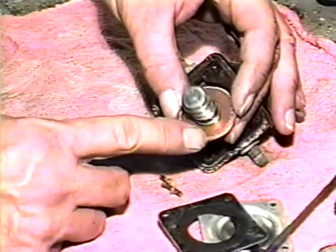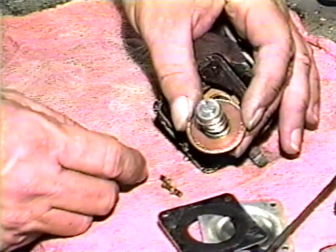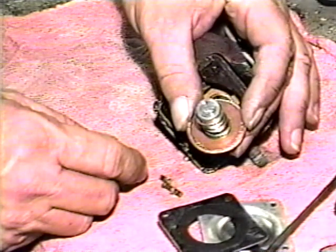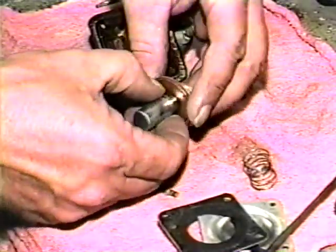Inspect the contact washer. Pitting around the contact surface is caused by arcing between the washer and the contact posts. This is normal if it is all the way around. Each time the relay operates, the washer should rotate slightly. If it does not, the washer will be burnt in one spot and the plunger should be checked for corrosion or damage.